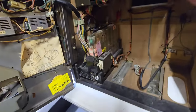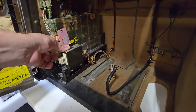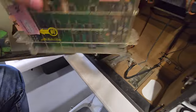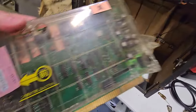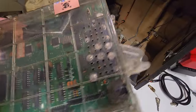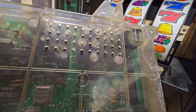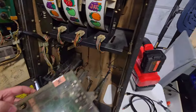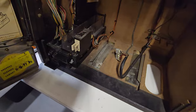Down here is the computer. It's a large ISA-style bus — look how crazy long that guy is. Notice this is security tape on everything; it's across the chips, and it's sealed completely. I do need to crack that tape off because look at some of these capacitors — see them bubbled out? So a lot of those filter caps that are on the power rails for this computer, they're bad. I already know for a fact that this is going to be part of my problem.